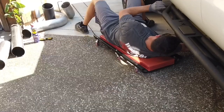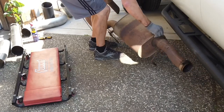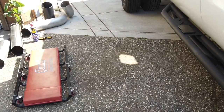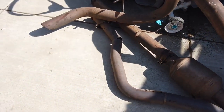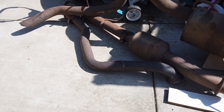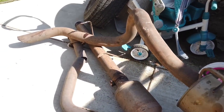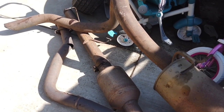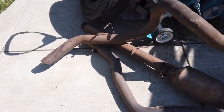Let's go ahead and remove the muffler. Alright guys, the hardest part is done — and that was a doozy. Here is the whole section that I removed. Now, if you noticed I didn't have a spare tire installed underneath the truck, and that's what kind of made it easier. So if you don't want to cut your muffler pipe section, just remove that spare tire and it is doable — it can be pulled out. But it is a pain in the butt, so if you don't want to save your exhaust, just chop it up and throw it away.